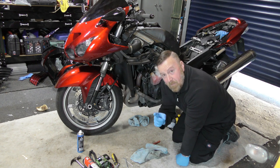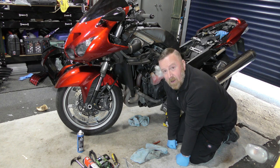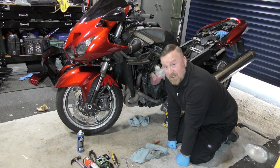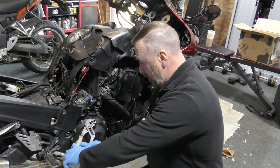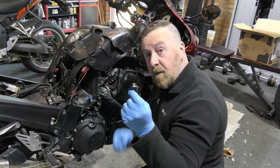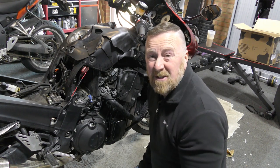Now fill with oil. Remember when you're filling with oil, get it just at the top. Don't forget — start the bike up, let it run for a little while, then re-top up anything you may need. Do not overfill. It's really bad overfilling these sort of bikes. Nice and simple. Some of these caps are stupidly tight — I suppose maybe to stop people messing with them. Some have a dipstick, some have a little viewing screen like this one does. Nice and easy viewing screen. Fill her up. How simple is it?